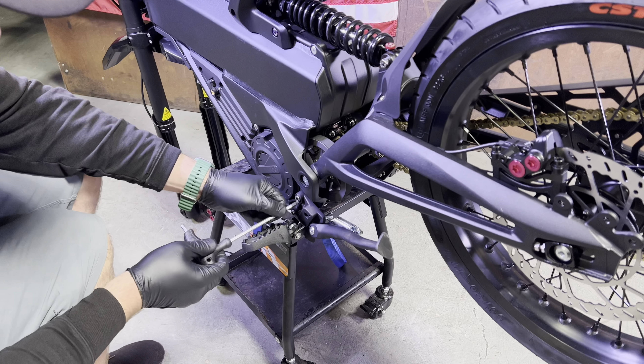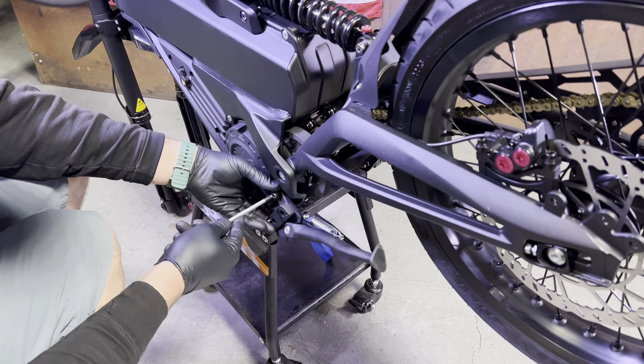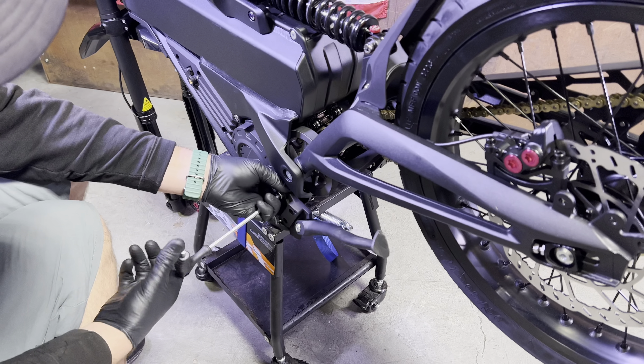Once you've got your peg off, go ahead and fully remove the bracket — but remember it's going to be attached by your little kickstand wire, so don't let it fall. You have a fair amount of wire coming out. Put a little bit of oil on this because it needs to thread out of here and into your new bracket. With a 12mm open-end wrench, loosen this little nut, then rotate the whole bracket to thread this all the way out. With the peg still on it would get in your way, so be patient — you don't want to twist the wire, you want to be sure it's unthreading. If you mess up this wire, they're probably not just going to send you another one.